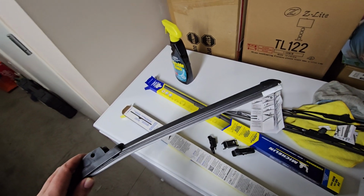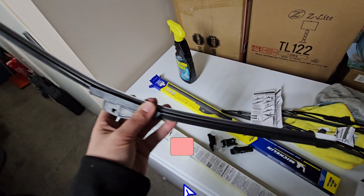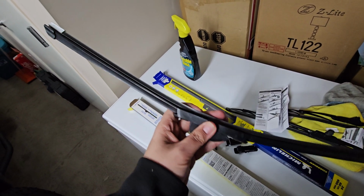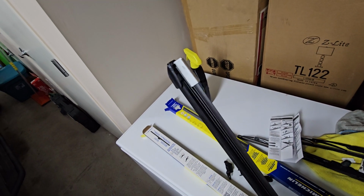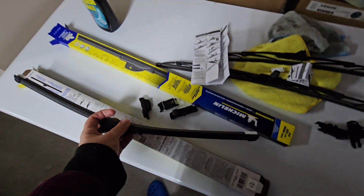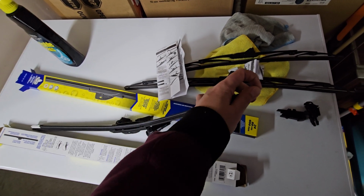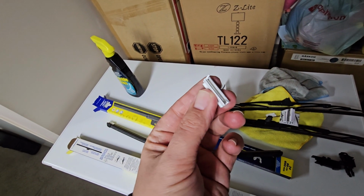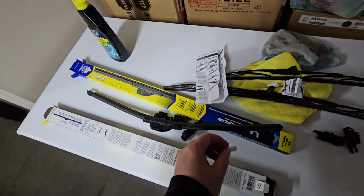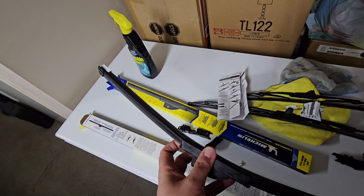And then, of course, Michelin must be kind of cutting down on the waste, because most of the wipers I've had in the past have a plastic sleeve all the way across the blade. And now they just have these 2 little white tabs on each end. So of course, before you put that on your car, just pull up and give it a yank. And you can see it's just got a little notch there holding that on. You don't want to wipe that on your windows. It's going to scratch it and wreck everything right away. So get those off, and then you clip it back onto the truck and you're done.